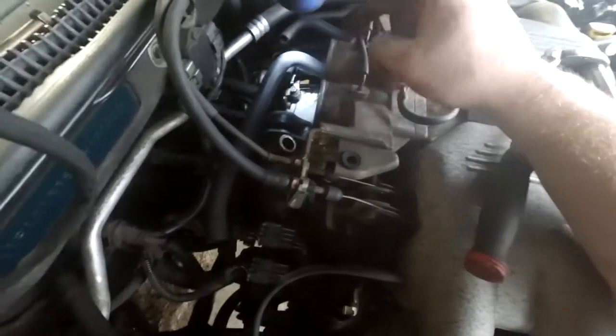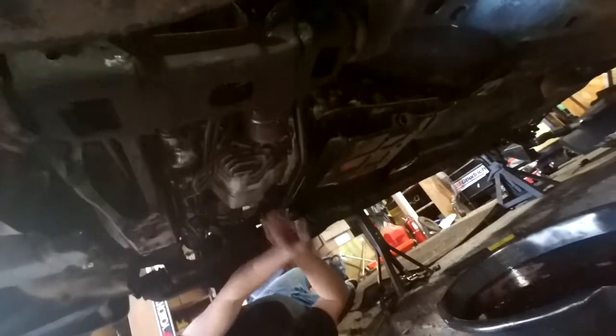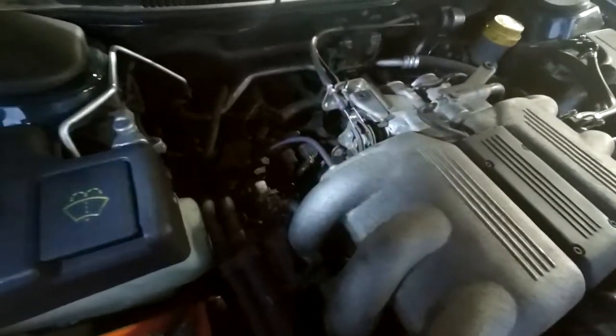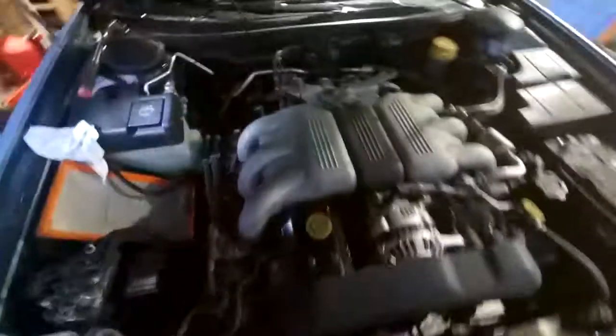We need to get to the actual transmission cooler lines. We're draining the transmission — it smells super burnt and disgusting. Right now we're going to take this subframe connector bar off; it's just these two 14s on either side. Super weird how this is in here, but I guess it helps support the subframe. Converter bolts are out — it was a huge pain in the ass. I had to hold the crank pulley from here, but you got a ratchet down on that side. I'll take out the little 12 mil bolts.